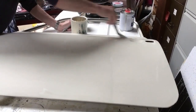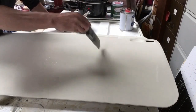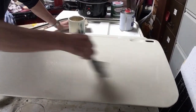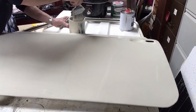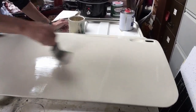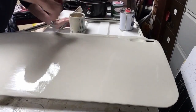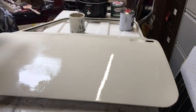A bit more paint, go over it again - watch not to get it too much in there because it'll run. Always make sure you go back over the piece you've already done by a couple of inches, and that way it stays wet. Just keep brushing it in. Checking for runs - you might find a run here and there but if you get it early enough there's no need to rub it all down. I'll just put a light on - that'll make it easier, oh yeah, I can see anyway.